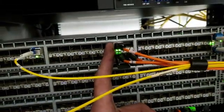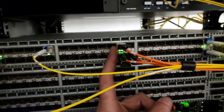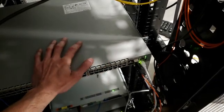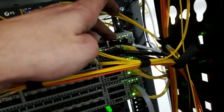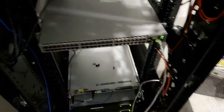We've got our 100-gig switch in the next room and that's bringing over these 40-gig 4x10 AOC cables. I'm only using two of the four, so I went ahead and took number three and put it down in this guy. That brings over a legacy network straight to this switch, and then I've got a 10-gig DAC cable going from this switch over to the switch for our new network. So this thing's fully ready to go — I just need to get OSPF set up on it.